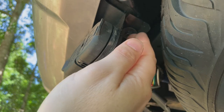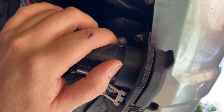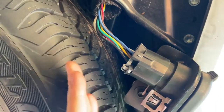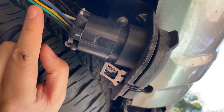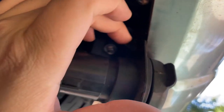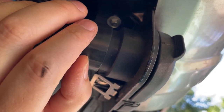Just get a drill and drill that out — I can't remember the exact size but it's not a big deal to figure out. The other fastener is the self-tapping screw that comes with the Hopkins bracket. I rotated this bracket so that it would point more toward the tongue of the trailer and also to get the connector a little further away from the spare tire. With the wire connector and plug out of the way, you can easily get to it — just find a place on the bracket and use your impact driver to self-tap right through it. It wasn't a problem.